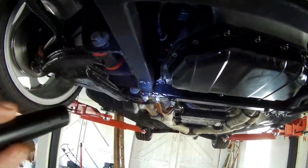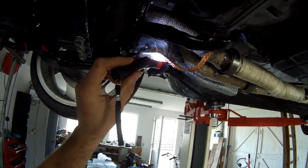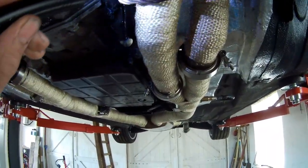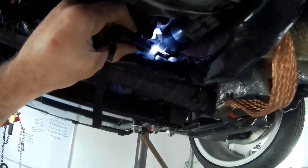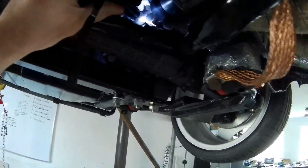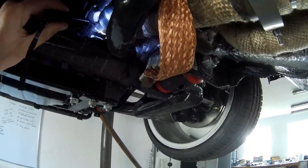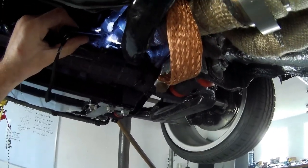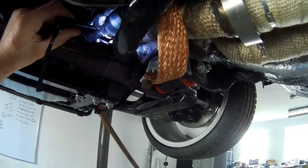So yeah. Also this one is connected, I ordered it, it's a 50 square millimeter earth connection. There's also another one over here, that was my standard connection to the transmission, I also use that again. Why am I using a 50 square earth connection? Because I also have a 50 square wire to my starter motor. I calculated it, and I don't know for sure, but there was a 2200 watt starter motor, so it could get to 180 amps. So 180 amps is a 50 square wire.